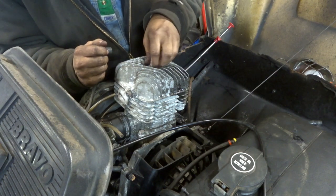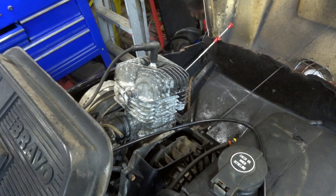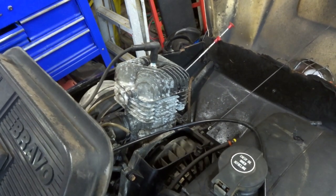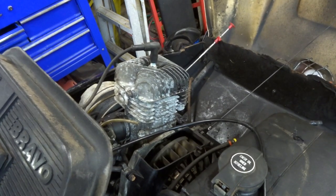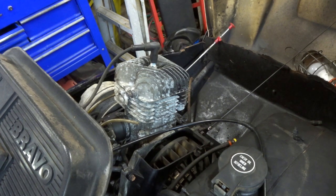And like I said, I did not clean this carb, so that carb could be right full of this white powder. I would not be surprised if it was. One last try, because my shoulder hurts. Okay. Tried to. Yeah, we're gonna fix the carburetor. So anyway, you heard it fired, so we got spark, we got compression. I'm not sure it's getting fuel, and I'm not sure it's getting through the carburetor, so we'll bring you back next time, and we'll rebuild that carburetor. We'll put it in the ultrasonic, and we'll go from there.